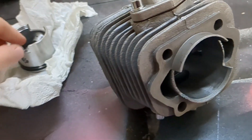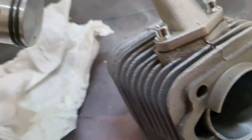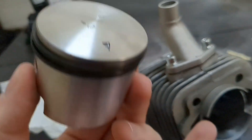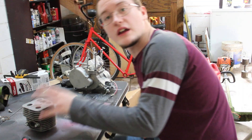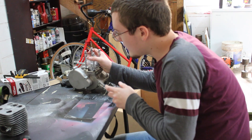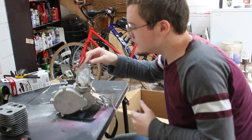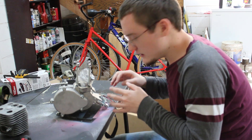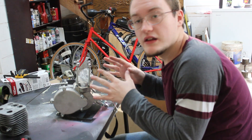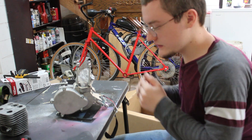When I actually bought this and unpackaged it, the piston was already in the head, but I went ahead and took it out. So for future reference, the arrow goes towards the exhaust. So now after I ported the engine cylinder, it's time to actually mess with the whole engine itself. I'm going to make it hopefully get more power by lubing everything up. Let's crack into it.